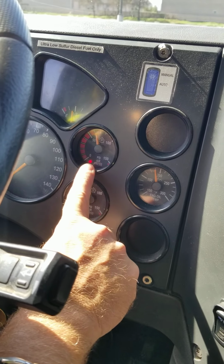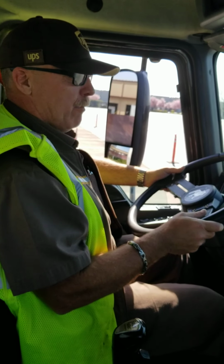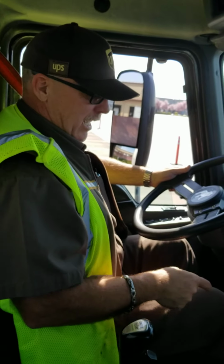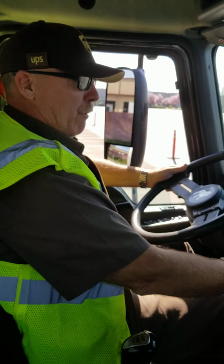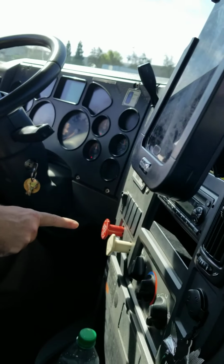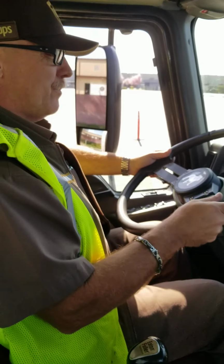I see the warning light and I hear the warning buzzer at 61 psi. My low air warning indicators came on at 61 psi. I'm now going to perform the spring brake test. For the spring brake test, I'm going to continue fanning the service brake with my right foot and dropping my air pressure on the gauge. When the air pressure drops between 45 and 20 psi, my trailer protection valve, followed by my park brake relay, should activate. I'm going to begin fanning.